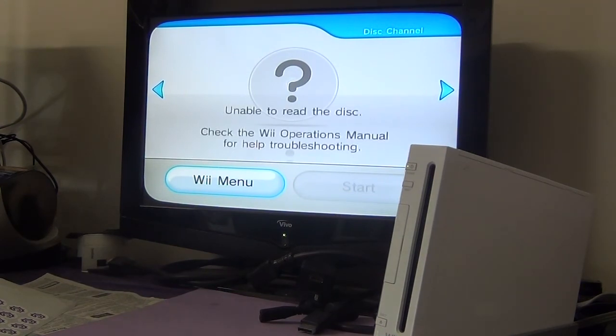In order to rule out what the problem is, you need to open up your Wii and check whether, when the disc is inserted, the laser movement assembly actually moves back and forth. If it does, then the issue is the failed lens — and many times it is the failed lens. In the next video, I'll open it up to confirm whether the issue is in the laser module or the movement assembly. Either way, we'll replace it with a brand new lens or a brand new laser movement assembly.